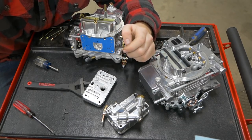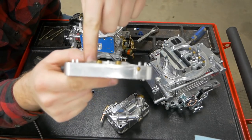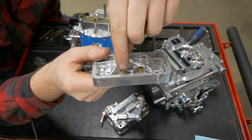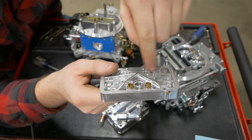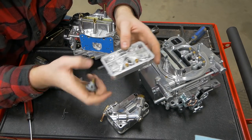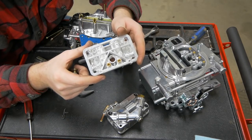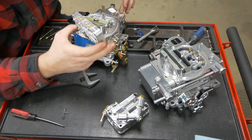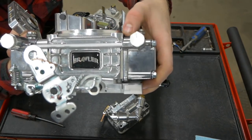Power valves are located on Holleys and Summits. An Edelbrock does not use a power valve — what they have is a metering rod that sits in the jet, hovering just above it to leave it open. As you pass the vacuum point where you need an enrichment circuit, this rod lifts out and allows more fuel to get into the full orifice of that jet. These are changeable on Edelbrocks as well. They're not just an on/off switch — they're a little more linear. There's a table from Edelbrock that shows you how to tune those. This metering block style — some carbs only have one up front, some like this one have one in front and one in back.